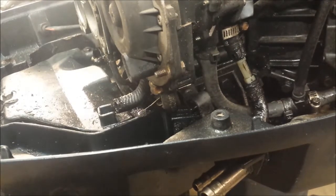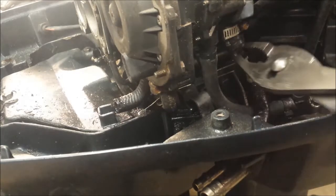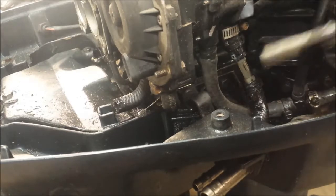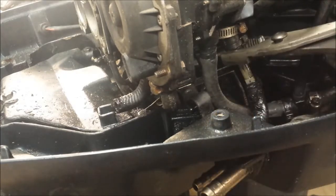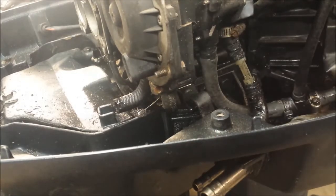All right, make life easy. I'm going to pull this VRO pump off — it's going to come off anyway. So if you see how I do that, I just break zip ties off and away I go. I've got two zip ties and an old hose clamp on this little assembly. Something tells me not all that was Evinrude's doing.